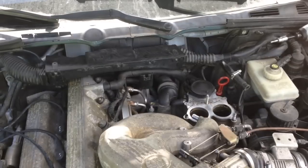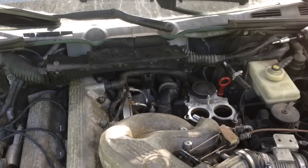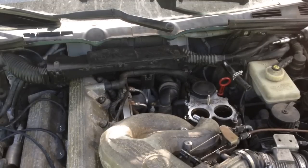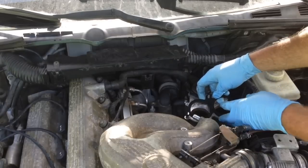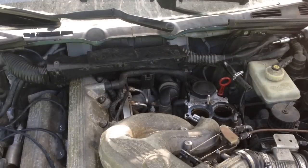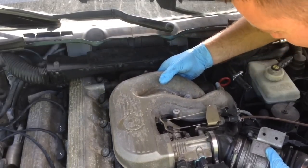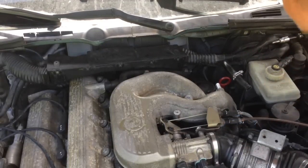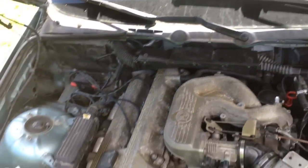There are no other lines off anywhere that we can see. We'll put the metal gasket back on the intake — you're not supposed to use sealer on these metal gaskets, and that usually doesn't cause a problem since it's not like it has oil in it. We're gonna set this guy back on here real gently, being very careful to watch where all your connections are and making sure that this big hose going to the bottom of the intake did not fall off — like it just did.